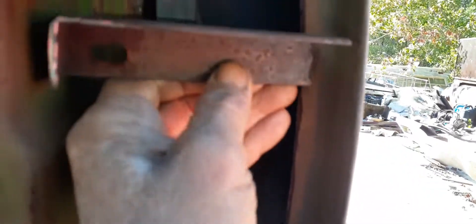I'm not cutting anything up on this car that can't be replaced, and the parts that I'm cutting are already so rusty they're not really worth fixing. So whatever I cut up on it can be put back and replaced to original without anything being butchered on this car. This right here — the fenders are just rotted out really bad, front bottom and back. This brace will go on that lower hinge bolt, and then this little part here will fit up in here like that — I'll weld that into the fender.